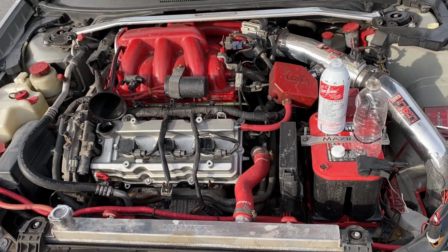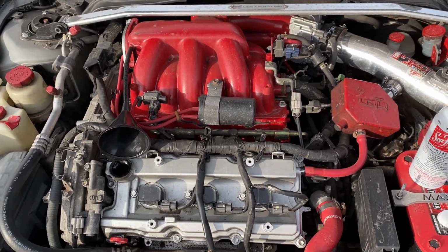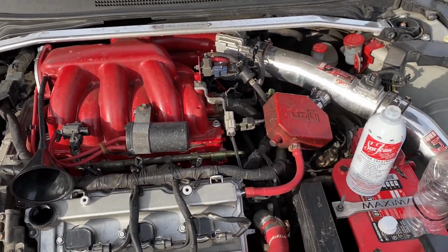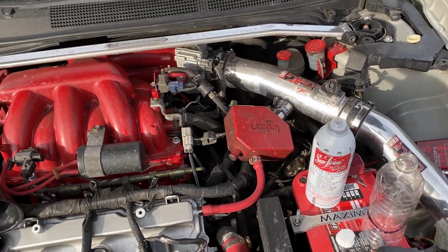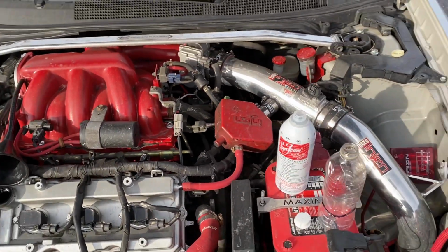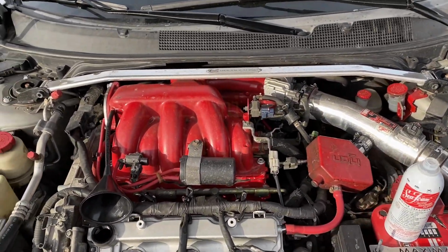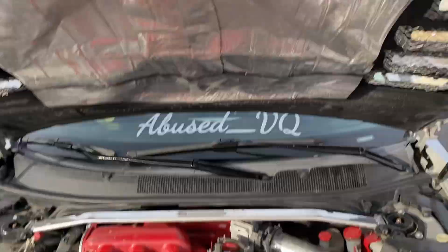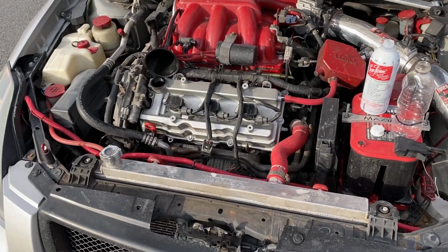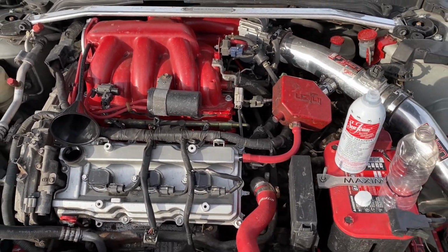So I've made a video like this before, but let me just make an updated version and everything in one video. So real quick, what we're gonna do is, boom. First two things you're gonna do when you're about to seafoam your car. One, you gotta drive your car prior to getting ready to seafoam it. So I've taken my car for a spin, checked the highway. The car is warmed up. Everything is at operating temperature, so we're good to go.